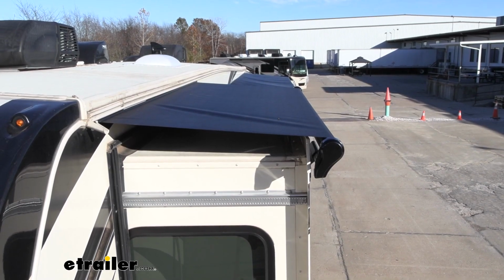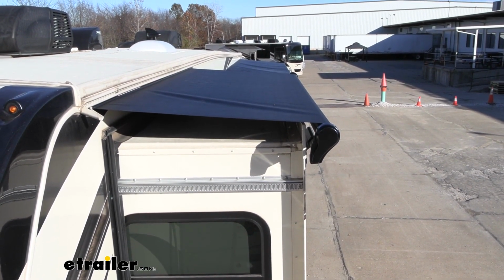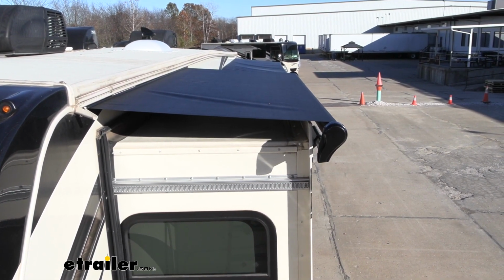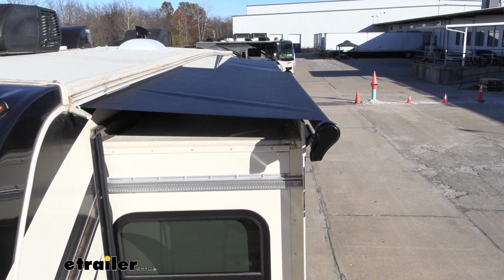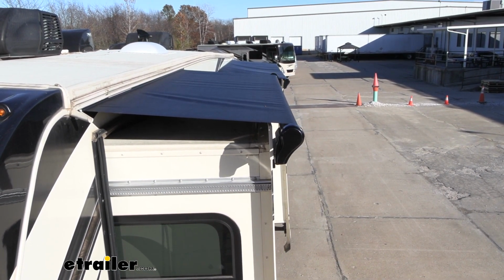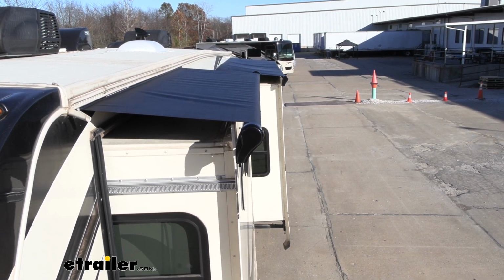Now, the best way to check for wrinkles is honestly putting your slide out and then also drawing it back in. And that's where a lot of times you're going to start to see some of those wrinkles forming. And so when you see a wrinkle, that was a good time to stop. And a lot of times you can even that out by pulling tension on the extrusion bead.